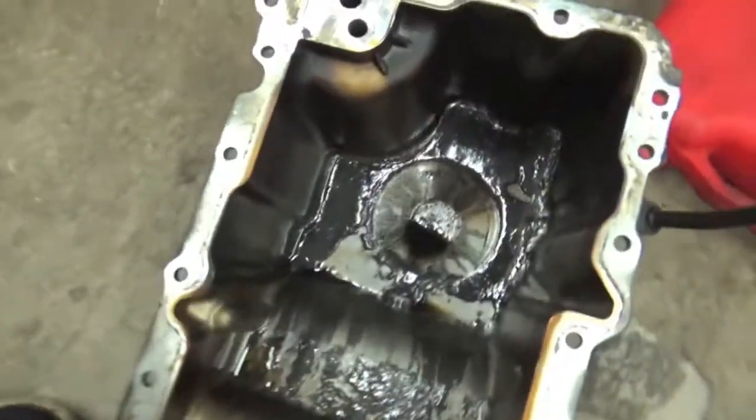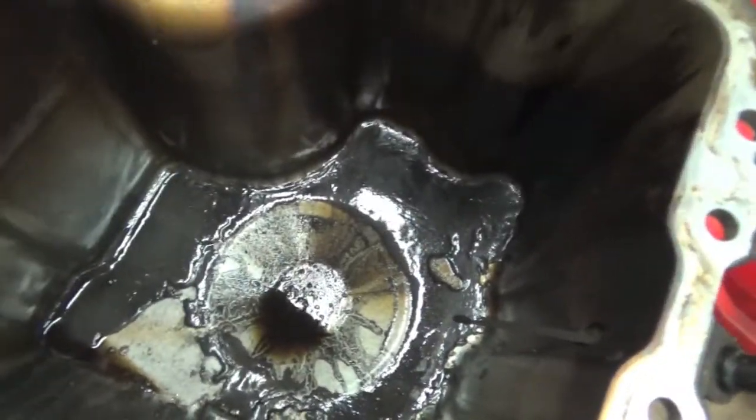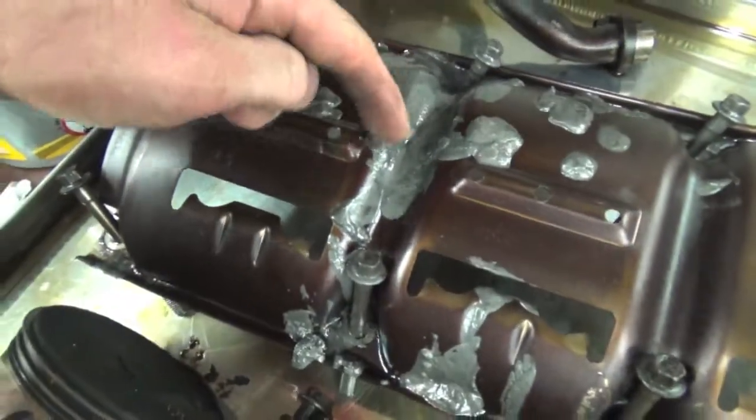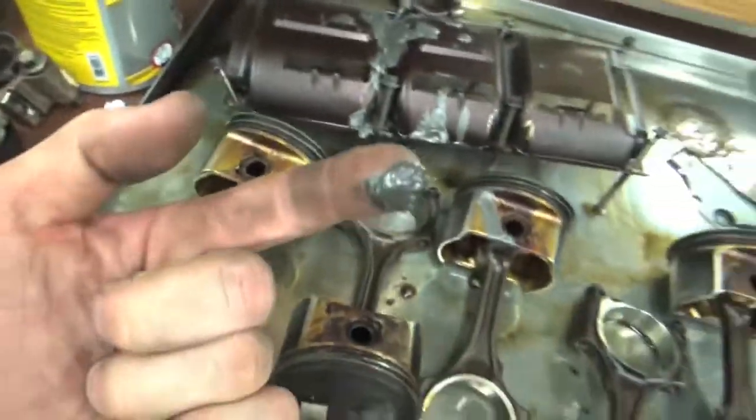We're going to call this a video. Next video we'll clean everything - I'll probably just clean everything off-camera - and then we'll start measuring bearing clearances and start putting this whole thing together. We still need to clean all the pistons and rods, and we got to set piston ring gaps too - that totally popped out of my mind. As always, thank you for watching, keep it boosted. Just look how disgusting that sludge was in that 3.5 - this guy had to keep driving it because it's literally everywhere. This is the windage tray - just look at this muck. Spun a rod bearing and just kept driving.